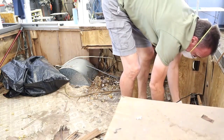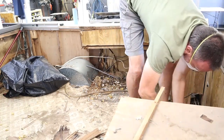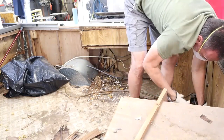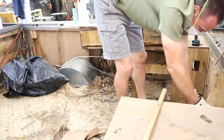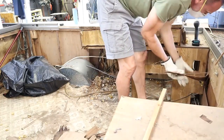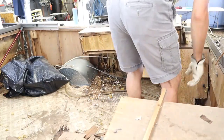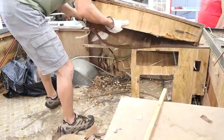This Jayco sat very, very low to the ground. I do intend to raise it up. It had no tanks whatsoever. I'm considering putting in a 20-gallon water tank and a gray water tank to catch it, just like my cargo trailer. I also plan to give the Jayco a lift. And so that will be a flipped axle and maybe relocate the spring mounts. It also had 8-inch tires and wheels on it, and those will go away. We'll be looking at some 15-inch tires and wheels as well. And that will contribute to a lift in the height of the trailer.